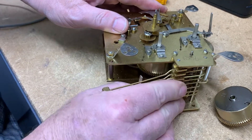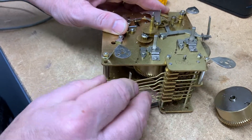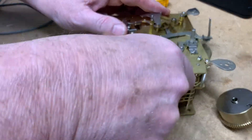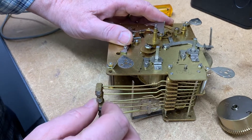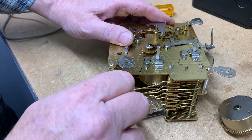If you need to get this one out, you're going to have to move this a little bit. These are brass, you know — you can bend them and then bend them back. You can tune your chimes that way too. If one's not loud enough, or one's too soft or too loud, or it's bouncing off, you can always bend these. That's not a big deal.